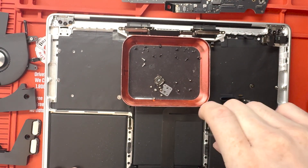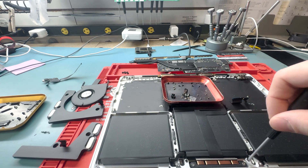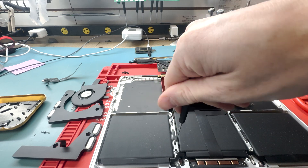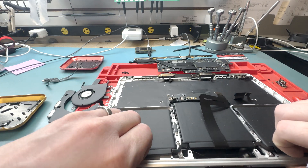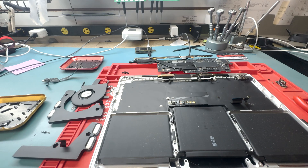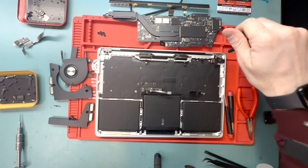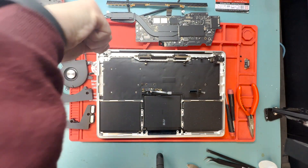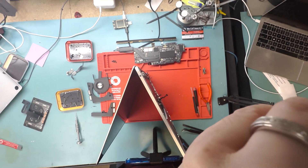Before fully removing the screen, I skip over to remove the trackpad. A lot of parts I've ordered came with the trackpad pre-installed and I've always had issues with them. So take out all the parts other than the keyboard and battery — those are the two parts you're replacing. Put in your own trackpad, charge port, power button, and auxiliary port so you don't have to worry about issues with those parts, unless that's what you're trying to replace, like liquid damage.